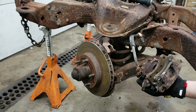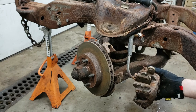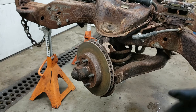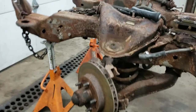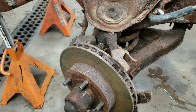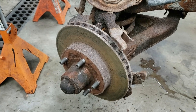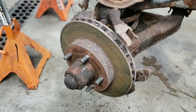Like I said, the brakes are like new - I just don't know how old they are and I don't know a whole lot about their condition, so rather than mess around with them, we're not going to. These ones are riveted, so in theory they wouldn't come apart on us, but I'd still prefer not to take any chances. To take the rotors off these trucks, we're going to pull the dust cap off, pull the cotter pin out, take the little retainer off, back the spindle nut off, and then slide the whole rotor off as an assembly.